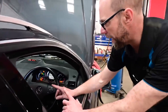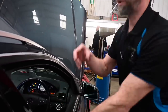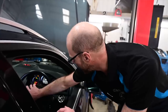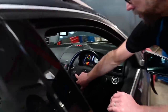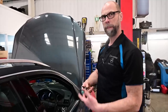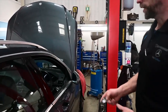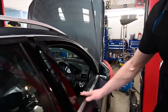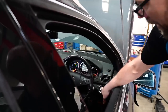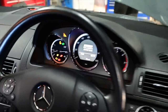What many people do is forget to reset the car. Once a bulb's out, they'll put a bulb in, but sometimes you need to reset using the return button on the steering wheel. Take the key out, sometimes lock it, wait for the dash to go to sleep, then unlock it — the dashboard comes back on. Lights on manually, go past the service one, and there we are, all cleared.